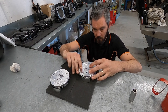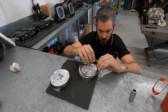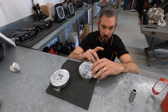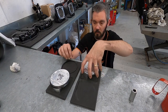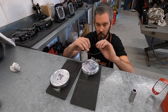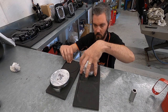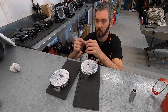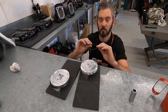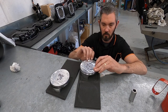Lastly, the piston ring orientation on the piston is crucial. Rings do move around the piston during operation, so setting them up in a manner that greatly reduces the risk of having the rings line up is paramount. Not only does it help keep the combustion up where it's supposed to be, it does reduce blow-by and ultimately reduces oil recirculation back through the intake manifold if you still run the standard breather system and you don't have a vented dipstick or trans cover.